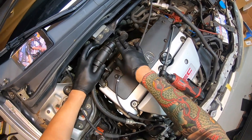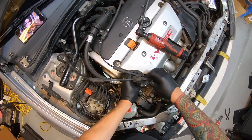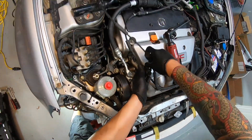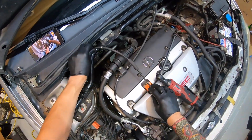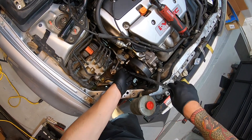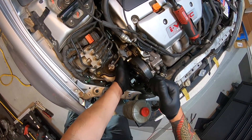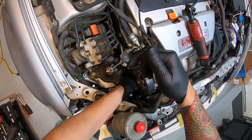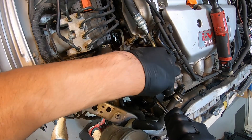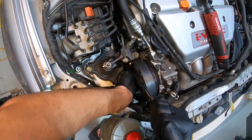I have a really big habit of putting all my nuts and bolts kind of back where they go — that just makes things easier later on. You've got to put everything back. The tensioner here is just a 14. I'm going to loosen this guy up. Having some long wrenches really helps out with this. I actually make a tool just for doing these belts to give you more leverage, but you can get away with just using wrenches.